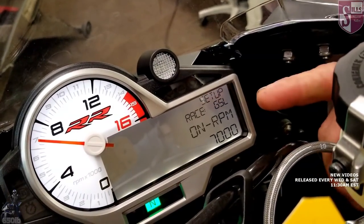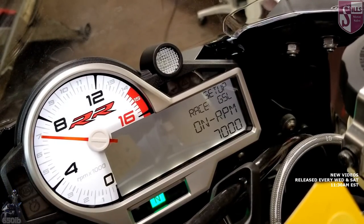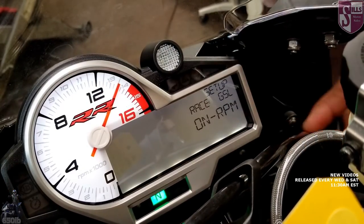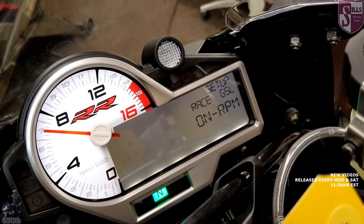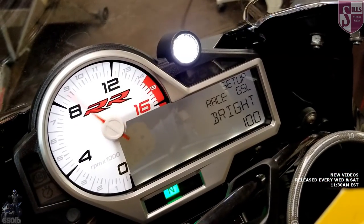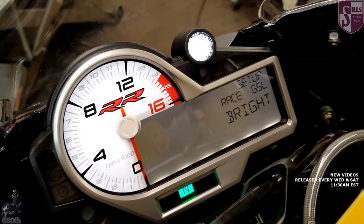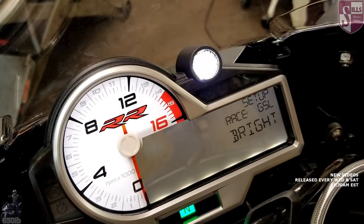We may have shown the tachometer change before, but if I want to change it I just hold the button — it flashes — then I can go up in RPMs. That's when my shift light is going to come on. We're going to go back down to 7,000 since we're breaking it in. That's when the light shuts off. This controls how bright the shift light is — you can adjust that easily. You should be able to see it getting dimmer. I just leave it at 100, but at nighttime that might be annoying so you might drop it down.